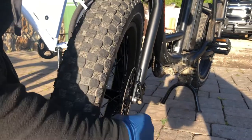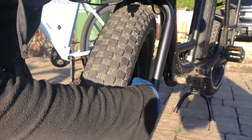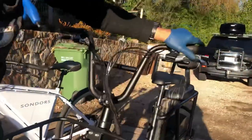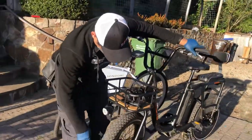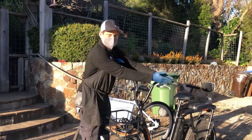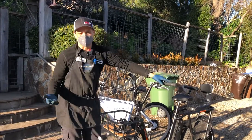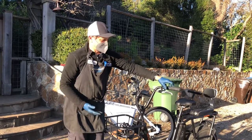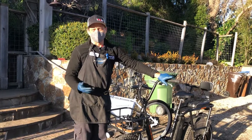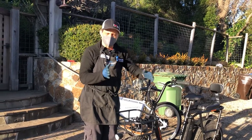That outboard pad sandwiches the brake rotor against the other pad on the inside. When there's extra room between the brake pad and the rotor, the brake lever will go really close to the handlebar and it won't feel very strong. If you don't have enough space, you'll notice the brake rubbing — sometimes that happens when the bike is new while the pads get accustomed to the rotor.